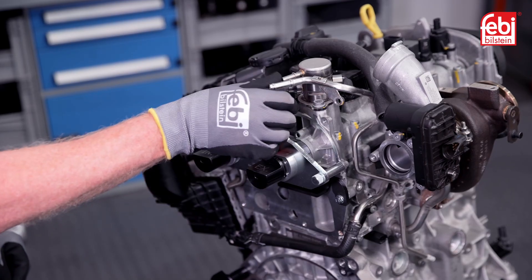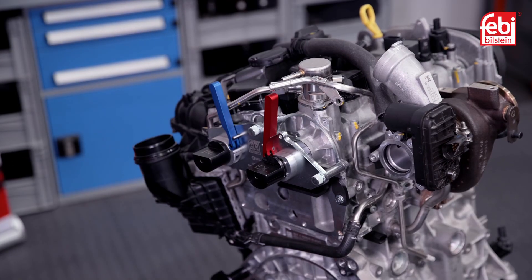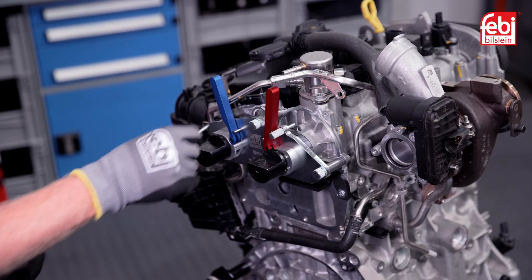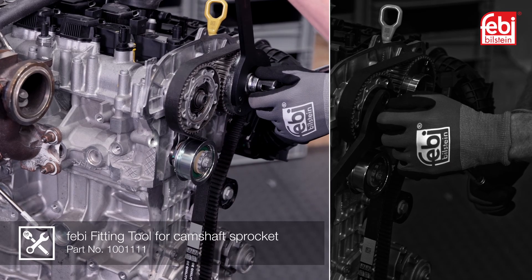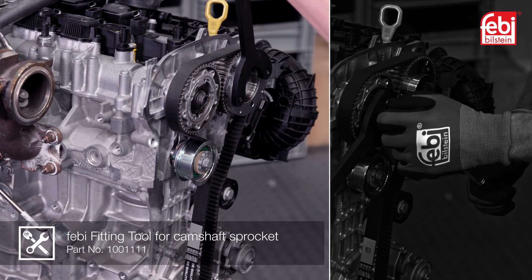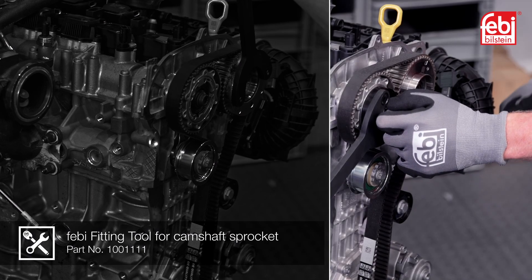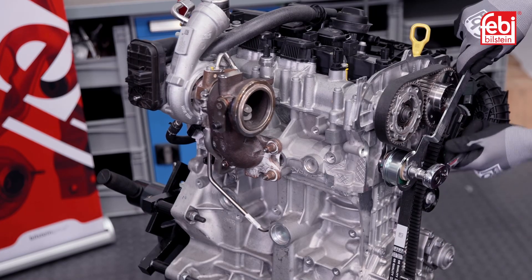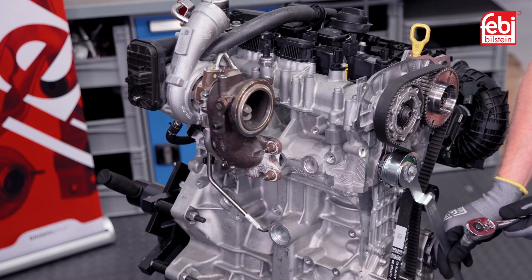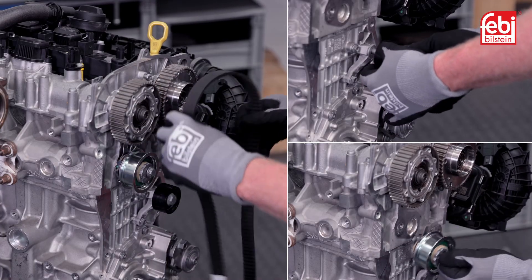To remove the timing belt, first remove the inclinometers, then lock the camshaft adapters by lifting the red and blue locking levers and inserting the lever stop pins. Using an appropriate pulley holding tool, loosen the inlet camshaft adjuster control valve and the exhaust camshaft pulley bolt, allowing the pulleys to move freely. With the crankshaft still seated against the crankshaft locking pin and the camshafts locked, remove the old belt, tensioner and idler pulley.